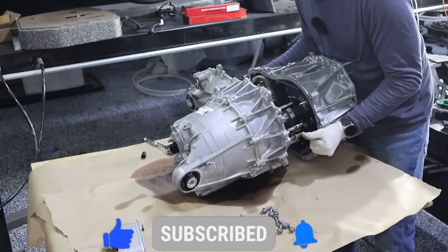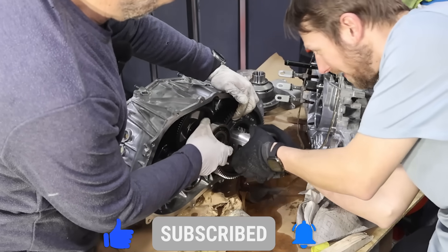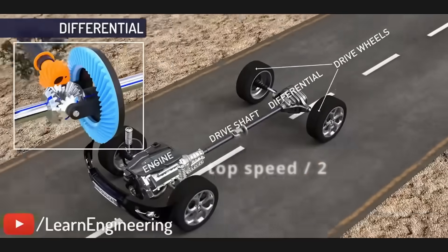In a previous episode, we did a gear reduction as well as a limited slip differential. The limited slip differential is so we don't just spin the back wheels or just the front wheels — we'll have essentially all-wheel drive. The gear set swap was required because the differentials have a two-to-one gear reduction.